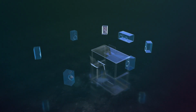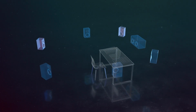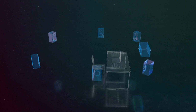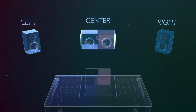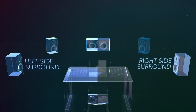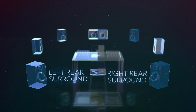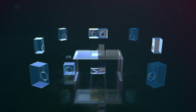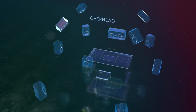Let's get into speaker specifications. In a 7.1.4 speaker configuration, you'll have 7 horizontal plane speakers around you. These are also known as your surround speakers. These include left, right, and center, also referred to as LCR, left and right side surrounds, left and right rear surrounds, a subwoofer channel, also known as your LFE, and 4 top surround speakers, which can often be referred to as overhead or height speakers.